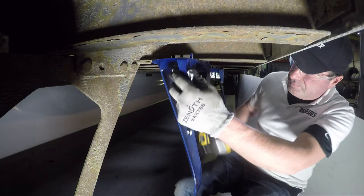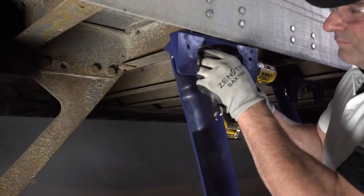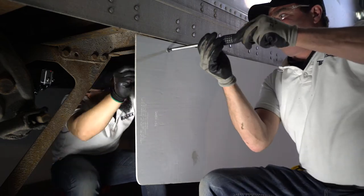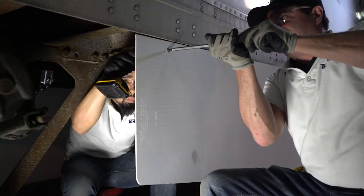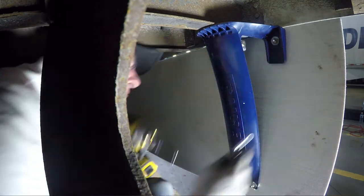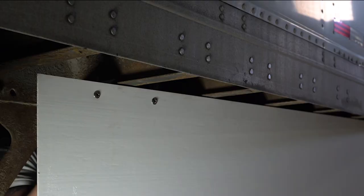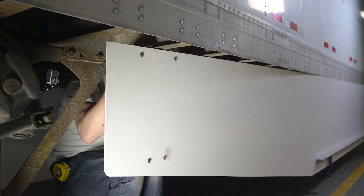Start from the front of the skirt. Secure bracket number 1 to the panel and push the bracket forward to align it with the side rail. Using only one of the two required bolts, tighten it temporarily onto the I-beam. The inside technician must drill through the top holes of the bracket while the outside technician puts pressure on the skirt. The outside technician must insert a bolt through each hole and the inside technician must insert a washer and a nut. The inside technician must tighten the bolts using an impact gun while the outside technician secures the bolt with a size 4 Phillips screwdriver. The required torque range is between 8 and 10 pounds. Secure the two bottom holes of the first bracket by repeating these steps. In order to create the front curve, untighten the first bracket and push the panel inward until the bracket touches the landing gear or until it is at a distance of 10 inches from the side rail. While pushing the panel inward, shake it well so that the rear panel is adjusted and the stress caused by the adjustment is released. Tighten the two bolts.